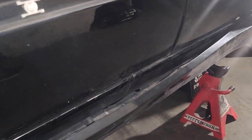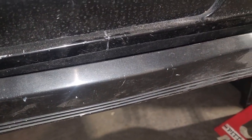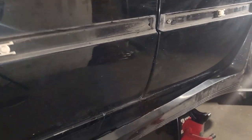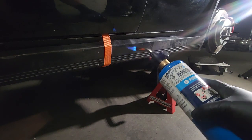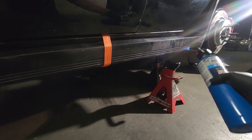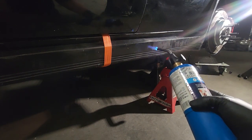So that's just with two on. Obviously, if you have a better fitting side skirt than mine, you won't have this gap. But what I'll do is cinch it in with a ratchet strap, go ahead and hit it lightly with a torch, and it will even itself out. Obviously, I'm going to want to finish putting the ones on the bottom first, and then the front ones so that it can be nice and smooth throughout. So I got it ratchet strapped nice and tight, and now I'll just go ahead and start warming up the side skirt. You will start to hear it crack a little bit, which is just forming into place. So you're going to need to heat it up quite a bit for it to reset.